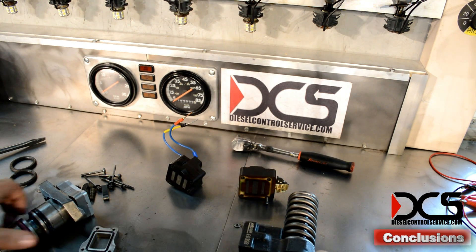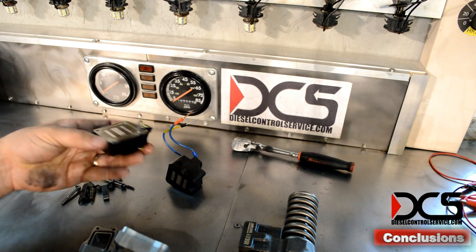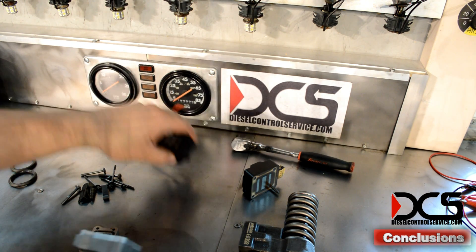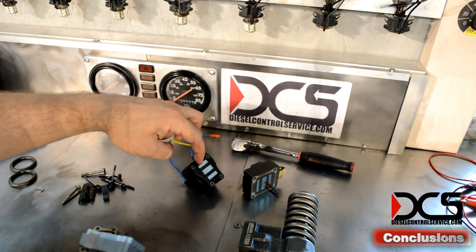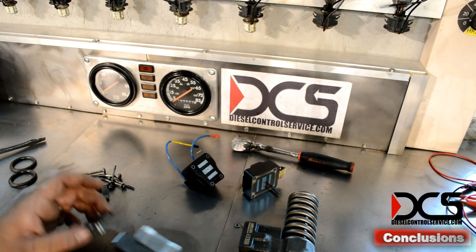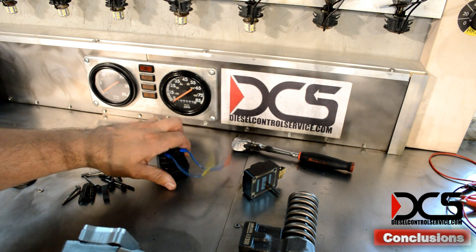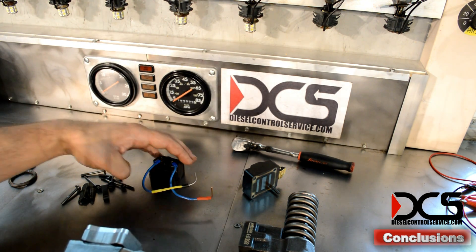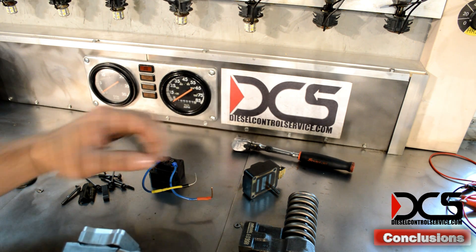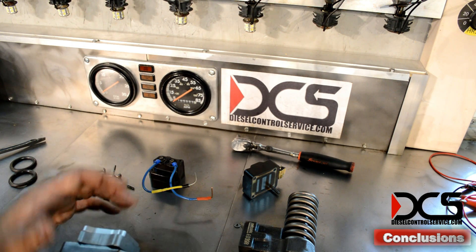That's amazing. The CAT, not so much. I was able to remove the solenoid — both of them — regardless of the 7-3 or the Series 60, and the CAT ECM did not throw a check engine light. The only thing it did was just kept on running, and I had to disconnect the circuit itself and set it to open for the ECM to respond and see that there was actually a problem.